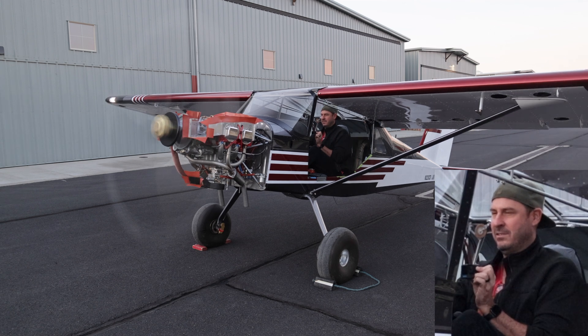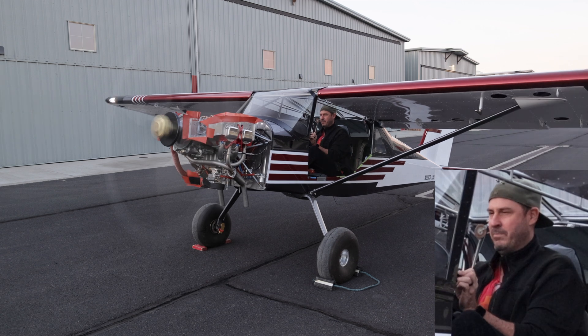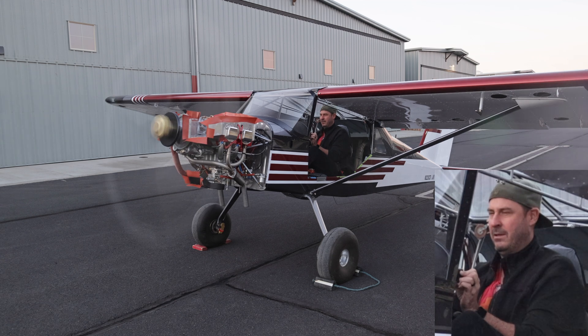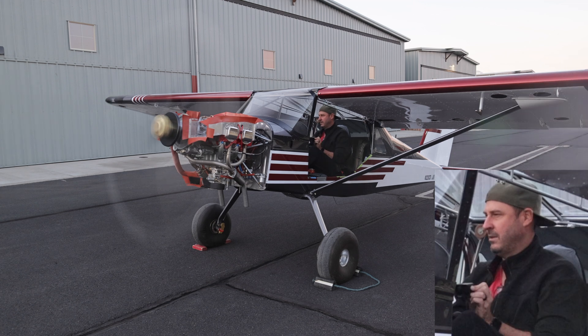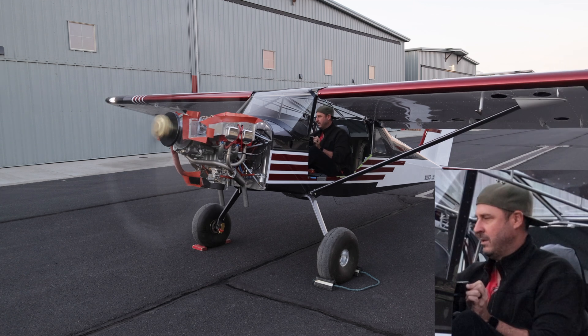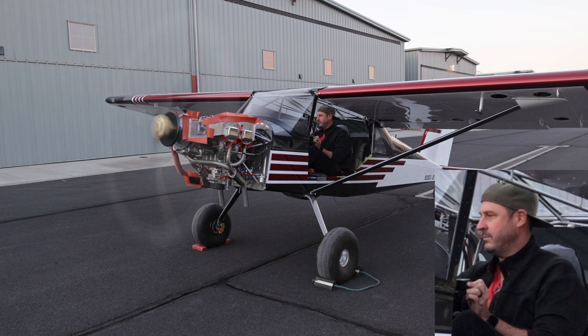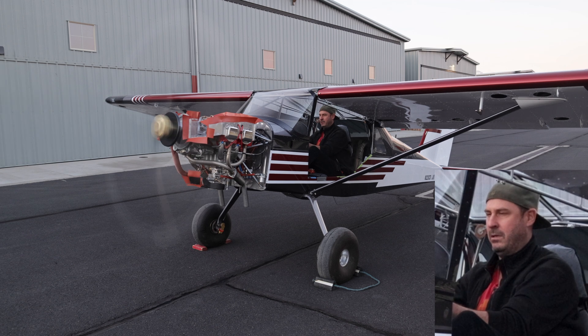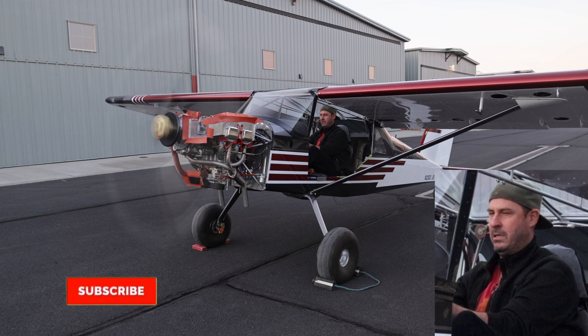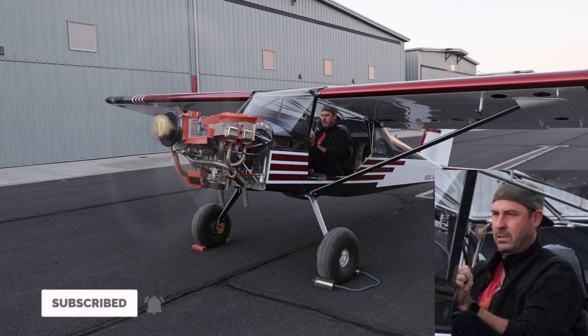Until first flight, which is only about two and a half to three weeks away in early January, I don't want to run this engine very much because break-in has to be pretty much airborne — a lot of power, a lot of heat. The only ground test runs I'm going to do are to test the RPM fix, do a taxi test, and then do a full power static RPM test to ensure I get enough power for first flight. I'm looking for 2,300 RPM at zero airspeed, starting with 17.5 degrees pitch on the ground-adjustable Whirlwind. I'll also be doing the new task-based flight test program and beta testing the EAA's draft test cards to provide them feedback before they're released.